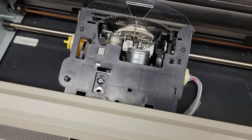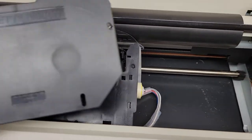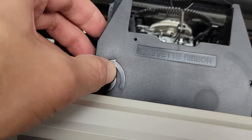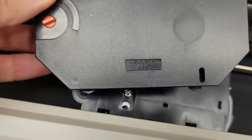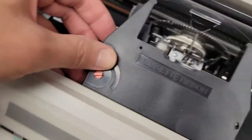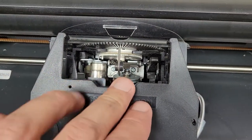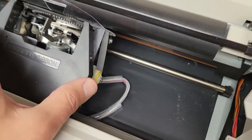Now it's locked in place and ready to go. Put your cartridge back in — it's simple again. Just line it up in the middle, make sure the bottom nubs are latched into the back, feel for it so the hammer is lined up in the middle, and push down until it locks in.